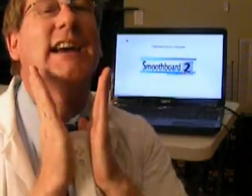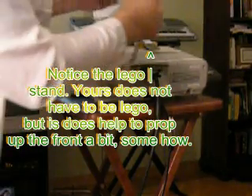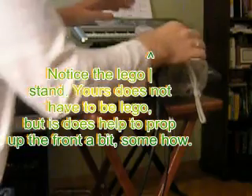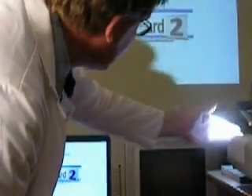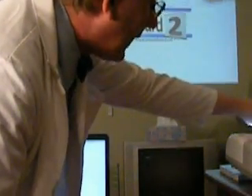Pretend I was the screen — you want to cover the whole thing. You don't want to be up here so that your screen doesn't fit inside of the 45 degrees. What I like to do is just take my Wiimote control and place it on top of my projector. If you've got a permanent setup, you pretty much only have to do this once — you can hang everything from the roof of a classroom and lock it down with screws and brackets. But I like to be fluid and put it right on top of the projector, because that way, when I have a shadow in the lens of the projection, I know I'm also probably blocking the view of the Wiimote. So I want to keep the tip of my IR pen out of my shadow and then I'm usually good to go.